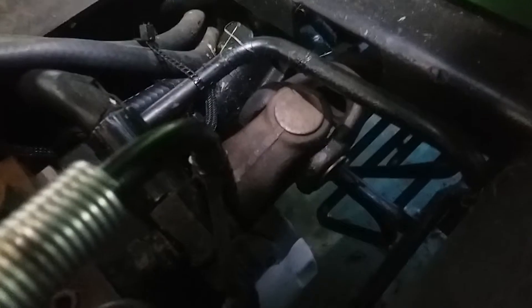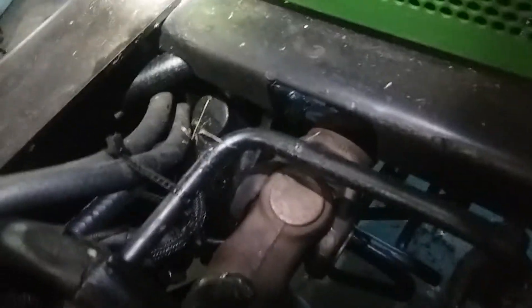There's the grease fitting right on top. Just put the grease gun on there. Push until you hear it click and then you just start pumping and wait until you see it start pushing out of the sides. Right there — it's pushing out in the back, right in there where it connects to the spline shaft.